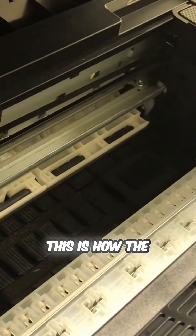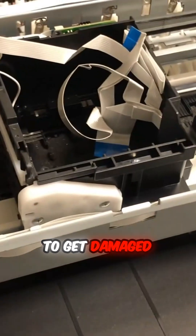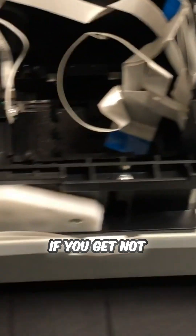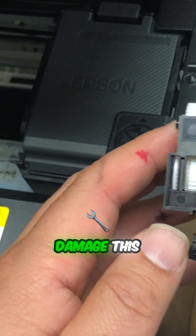This is how the printer powers off. This piece of plastic is easily damaged because the printhead is moving at a high speed. If you're not synchronized, the printhead might strike this plastic. Also, during a paper jam, you may be fighting the printer and damage this plastic.